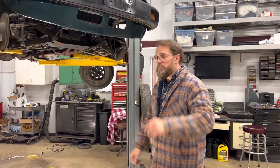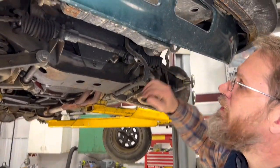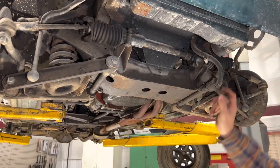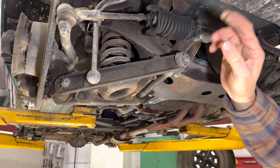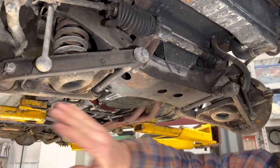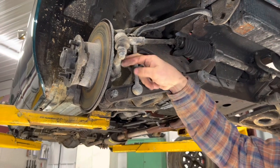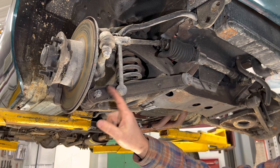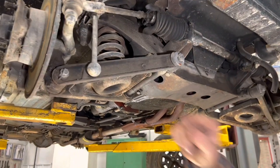So we're going to do a quick look here. Obviously we need rack boots. Bushings here are about as expected — got the rear ones a little worse, so we may end up putting bushings in it. The internal tie rods seem okay. There's a little bit of play in the bearings but not that bad, and the kingpins don't have much play in them. But this bottom bolt might be seized in the lower trunnion on this side — we'll have to look at that closer later.